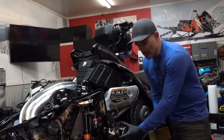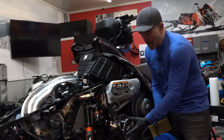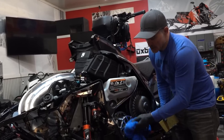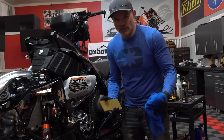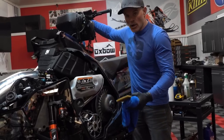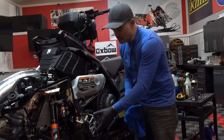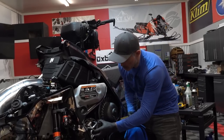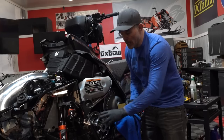I would definitely take great care in popping off the primary cover and inspecting the spring. As you put that back on, take great care with how you put that cover back on, whether it's aftermarket or stock. I've got a rag just cleaning up the exterior and some of the dust associated with these things going a million miles an hour. Before I even put my hands in here, I make sure the key is off and my kill switch is off before I start to rotate the primary clutch. You've seen how you can primary-start a sled — rotating this thing in a given direction, we wouldn't want our hands anywhere near it if it decided to fire up.